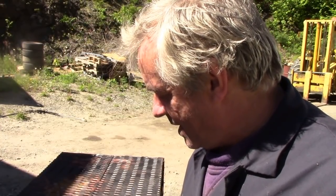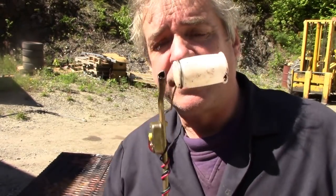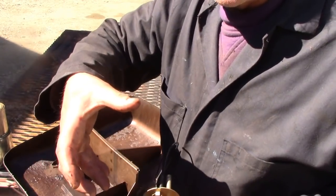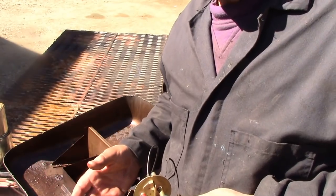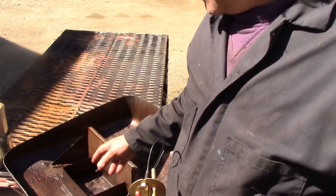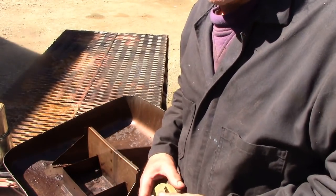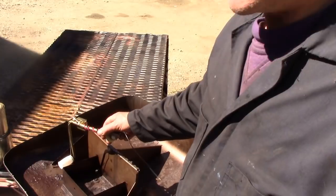But there you go. Yes, you could have washed it out, but you couldn't guarantee everything was out, because once you've washed out a tank and it's got trapped debris, the first thing it's going to do is get sucked into your fuel filter, and you just don't want that. And this is why we had problems once before, and I mentioned it, about these senders picking up leaves and bits of paper in here because it can't get out. You think about it. If you've got a piece of leaf floating around in the tank, and believe me, the Defender fillers are so big, anything can get down there whilst you're filling up your fuel. You leave your cap off or something, and it gets all sorts of muck in it. I've had countless cars with leaves in tanks, but it gets into this chamber here and it can't get out. The only time it gets out is when it goes over the top into somewhere else.